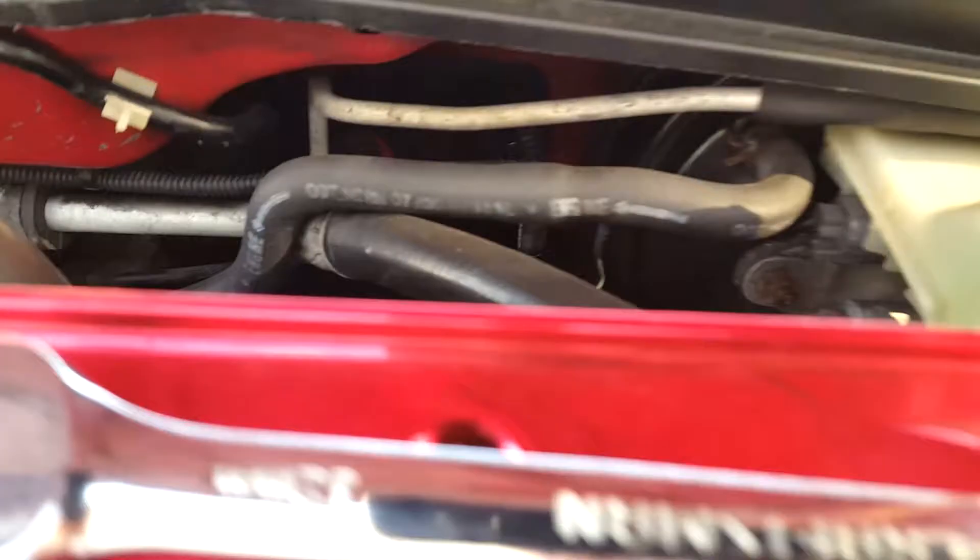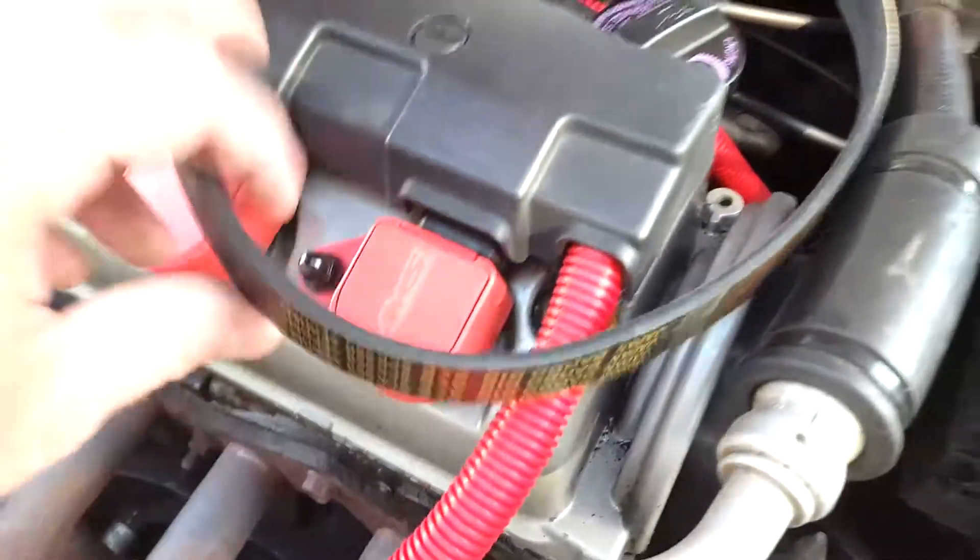I already have my power steering permanently removed, and a little loopback thing down here by Devsport. So I'm just going to take this belt off now with the 12mm bolt down here and slip the other one on.